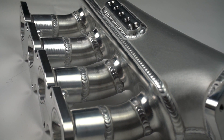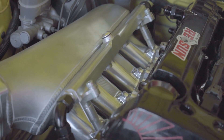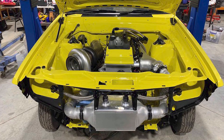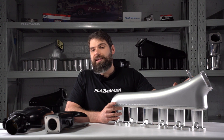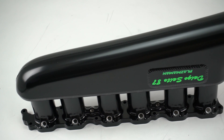So let's say you've got a bigger turbo, bigger camshafts, or cylinder head porting done. How's that intake manifold going to help improve power? Going back to the start of the video — your engine is basically a big air pump. The faster you can get more air in and out, the more power you're going to make. If you've done modifications that allow your engine to take in more air — a high lift camshaft, a ported cylinder head, or a turbocharger with more boost physically pushing more air into the engine — this is where a larger intake is going to help you make more power. The larger intake volume allows the cylinder head to accept the air it needs, and the larger, shorter runners help the engine continue to make more power higher up in the rev range.